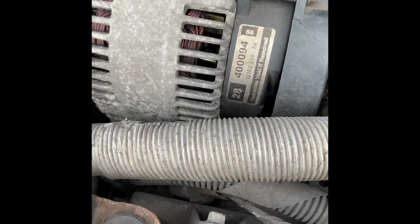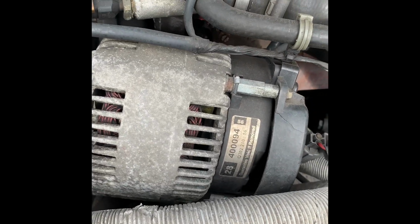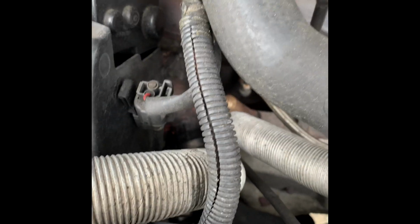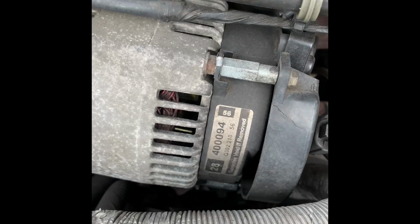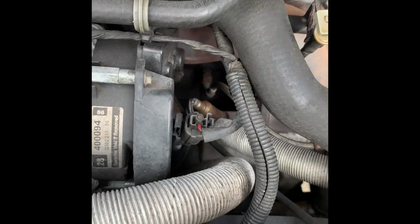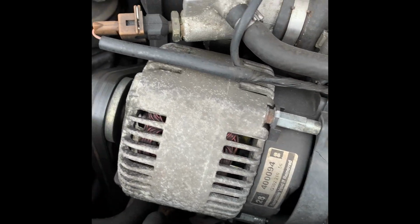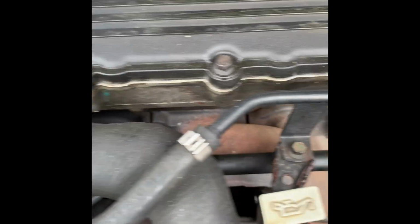I had a bit of a problem with the alternator once. The lights were flickering at night, and all the electronics were flickering. One day it's probably going to need a new alternator, but what I did was take the regulator brush back out, give it a bit of a clean, and clean all the contacts on it. There was a lot of carbon build up from the brush. Blew all that out and put it in, and it's been fine ever since.